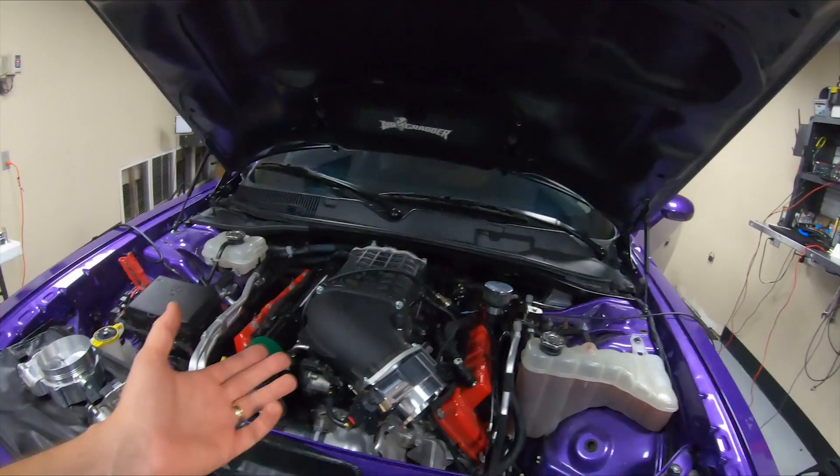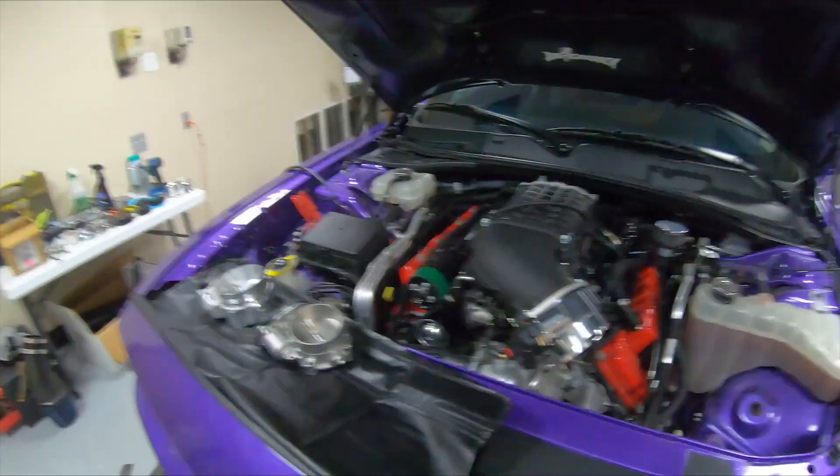The 105 millimeter is great especially for the stock blower if you can find one. However, this 2.65 liter TVS can move much more air than the stock twin screw or even the Demon 2.7 liter twin screw. We know that from everything we've done with our Mustangs, our GT500s and our Coyotes — we've seen 11, 12, almost 1300 rear wheel horsepower out of the 2650 TVS. So we thought to ourselves, let's put one on a Demon and let's try to make similar horsepower numbers.